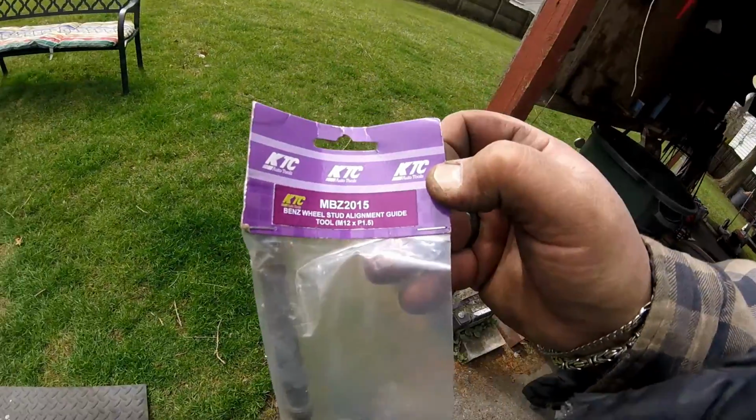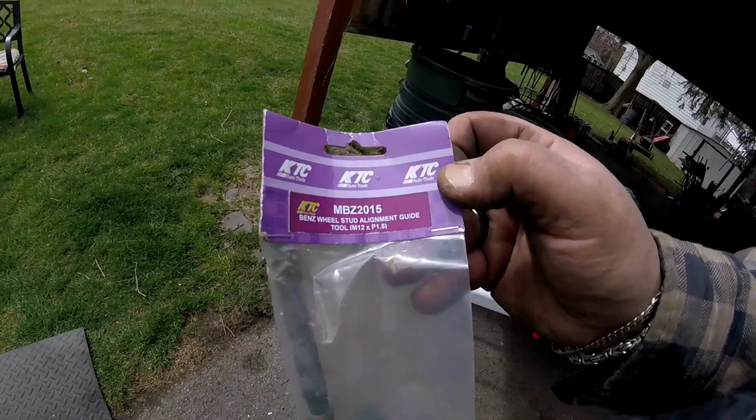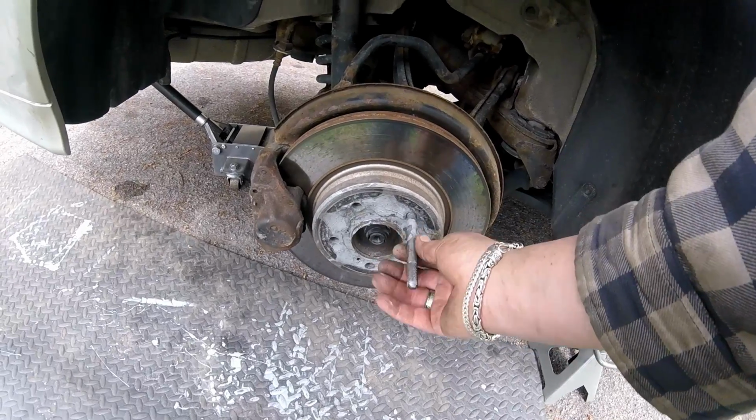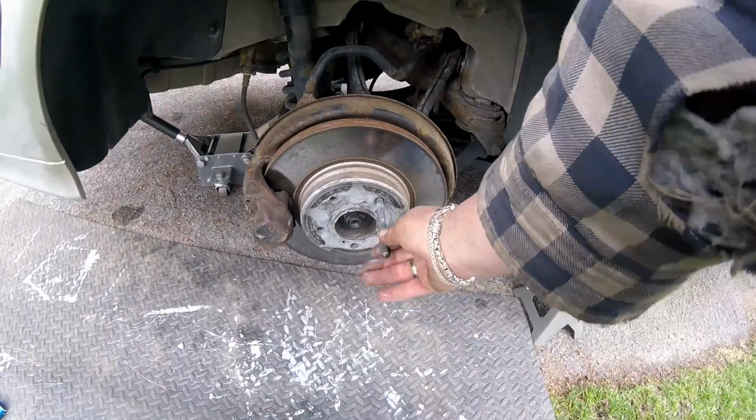Show you guys this. This is a must-have if you own a Mercedes. It's a Benz Wheel Stud Alignment Guide tool, MBZ2015. I'll see if I can find a link for this on Amazon for you guys. I'll post it at the end of the video in the description. You know how the European lugs are. They're not like the studs coming out. The lugs have the thread on it. You just put this in, then you can hang the wheel on that, and line up your lug holes and be done real fast throwing your tires on and off. Excellent tool. Great to have. I got one in the car in case I get a flat. So pick one of them up. Save you a lot of headaches.